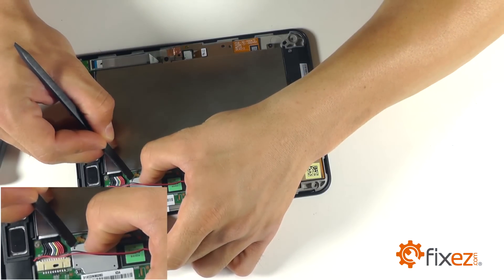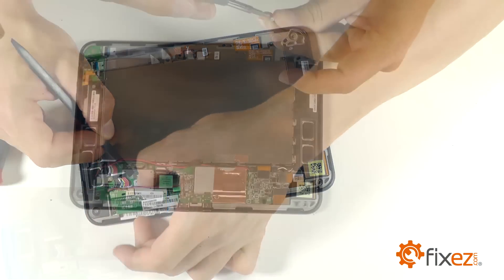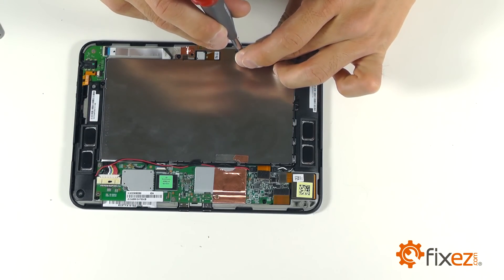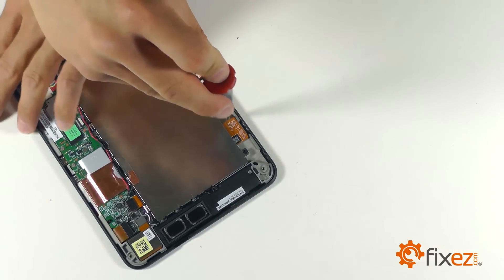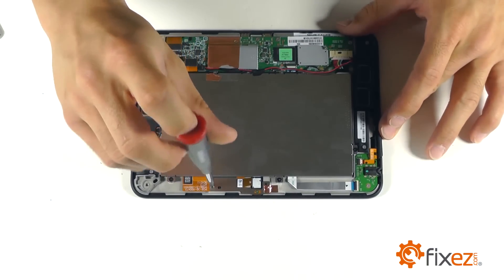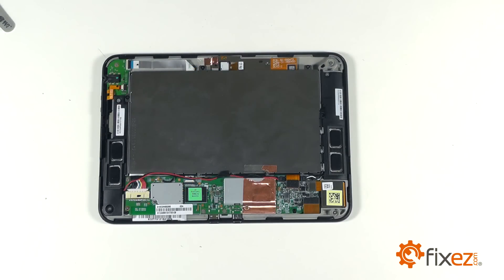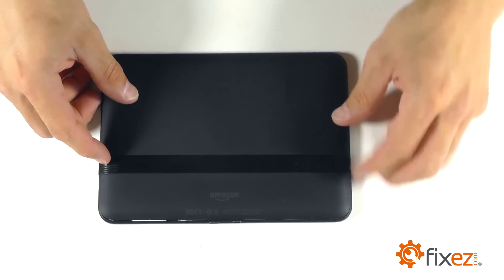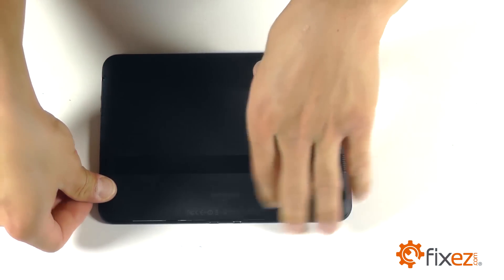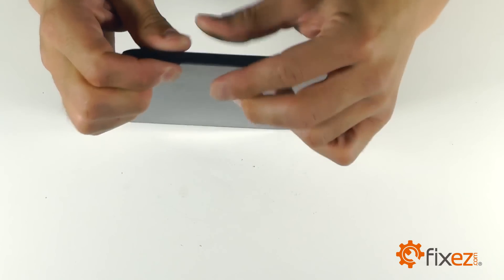Route the wire into the channel of our battery plate and secure the coaxial connection at the end of that wire. We can now finish with the rest of our securing Phillips screws around the perimeter of the Kindle. We are in the home stretch of our assembly — we can now bring in our back cover and begin clipping it all the way around the perimeter of the unit until it's securely in place.